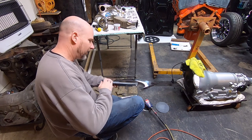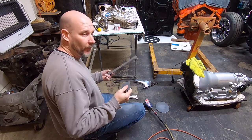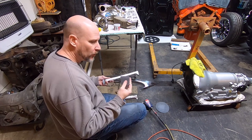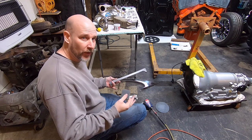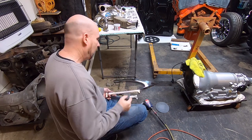Finally decided to shut off. So that was 1000 grit on DA paper. Now, I don't have any 1500 or 1200 on the DA. Normally I would go to 1000, 1200, 1500 on DA paper. Then I'd move on by hand.